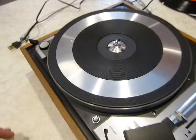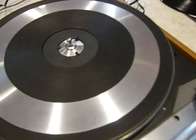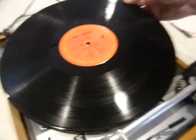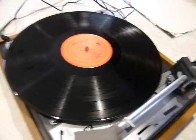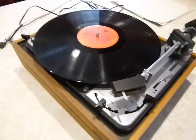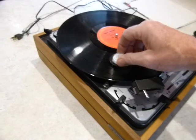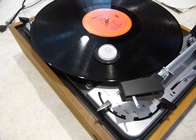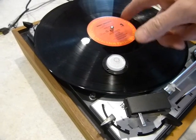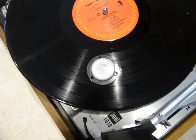So to overcome this, I take a flat record, one that I'm not going to damage, but that wasn't maybe worth hundreds of dollars. So you're just going to take an inexpensive, replaceable record, if you like, from your collection. And just make sure it's flat, so it's not wavy, warped or anything. And then you're going to put your spirit level somewhere on the arc between the arm and the center of the record, because this is really the critical area that you need to focus on.